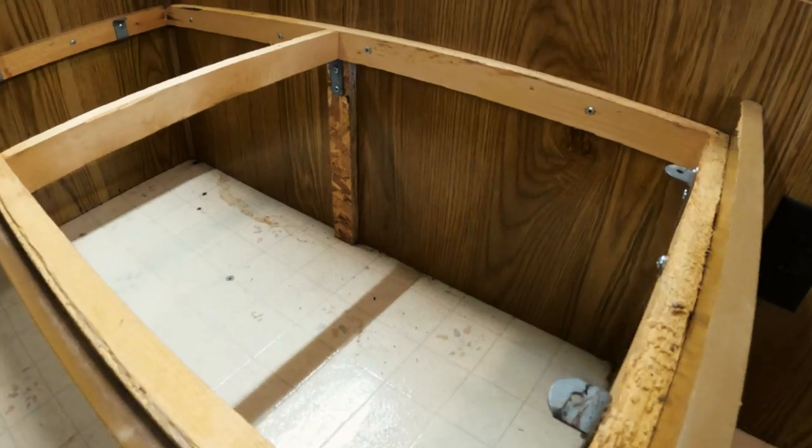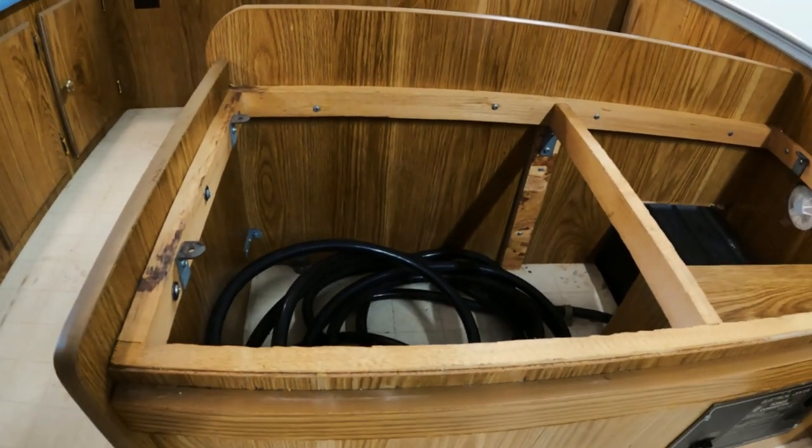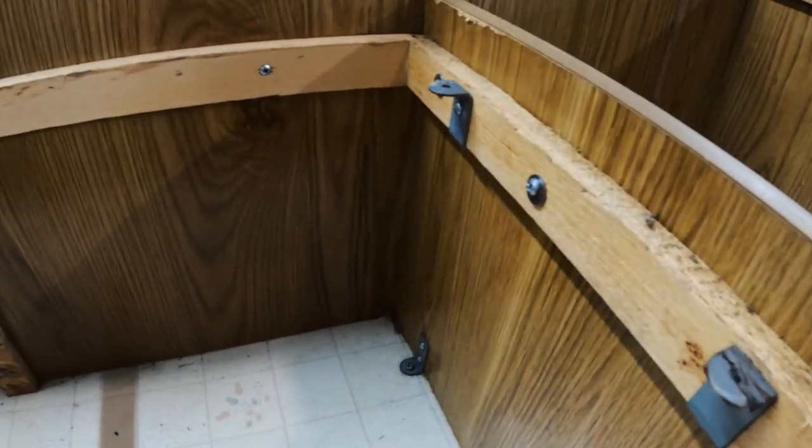So if you need to replace a section of cabinetry, you want to take it out — do whatever you want to do — I'll show you how it's constructed on the Destiny Series to assist you in your repair or rebuild. The cabinetry in your Coleman or Fleetwood Pop-Up Camper is wood and stick built. We can see that they use some one-bys to frame out the construction, and one of the most popular fasteners you'll find in your camper are these right-angle brackets. They'll use these a lot for areas that require more strength, such as this dinette area. We find them along the top and the bottom, securing the bench seat areas to the sides and the floor of the camper.